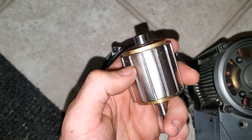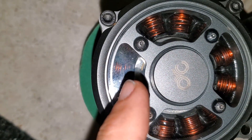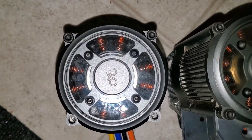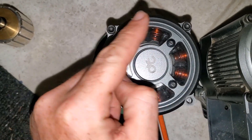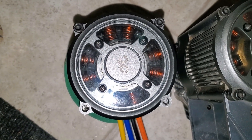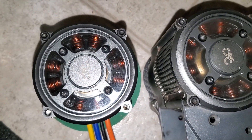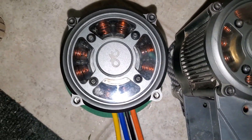So CYC changed the style of the rotor to incorporate a metal casing top and bottom - you can actually see the metal casing here on this motor and also on the motor that was in the bike. The problem is this can now cause contact issues with the stator, which runs around the outside, causing overheating. I was told it only occurs at high RPMs, so I thought if I just keep it at 52 volts and 8500 RPM max it wouldn't be an issue.